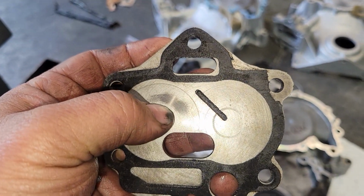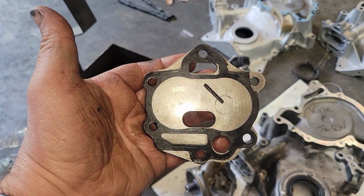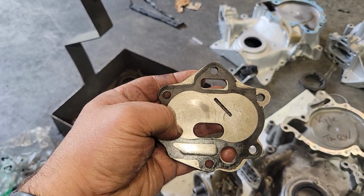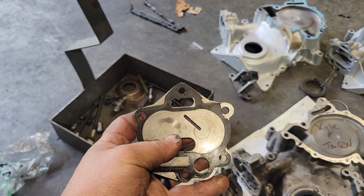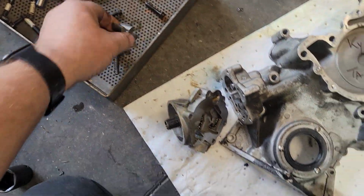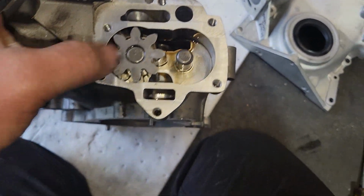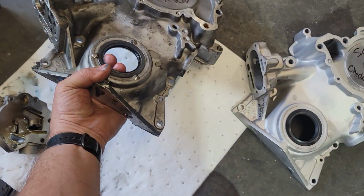Look, right there. Okay? When setting the oil pump clearance, we're only setting the oil pump clearance to the tightest spot. So if this is at 2 thousandths, where is this? Is that at 3 or 4? Where is this? Is that at 4 or 5? We don't know. This is why you want this plate flat. You want your gears flat. You want the depth in your pocket to be perpendicular with the surface. That way it's true. Are we going to get it perfect?